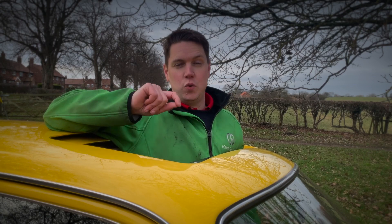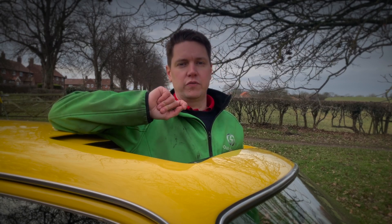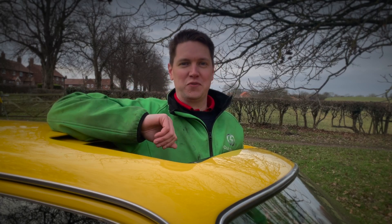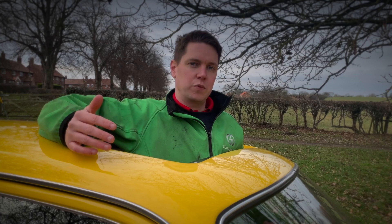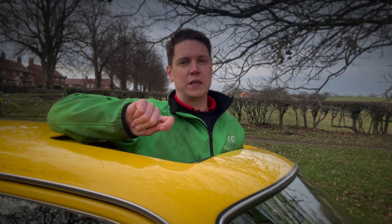This particular vehicle posed quite an opportunity and a bit of a challenge for us. Normally when we take a classic vehicle, the number one place to put batteries for the electric conversion is in the engine bay — the engine comes out, there's a big space, so let's put batteries in there. But this customer had two reasons why that wouldn't work. First, he really values his boot, and in the VW Variant the engine is quite low down, so any extra space would have to come into the boot — the customer said no way. Second, the Variant naturally has slightly wobbly steering, like most VWs of this period. The front of the vehicle is traditionally quite light, making the steering a little airy. Splitting the battery pack would improve weight distribution over the front axle and help with that steering, which has made a really big difference.